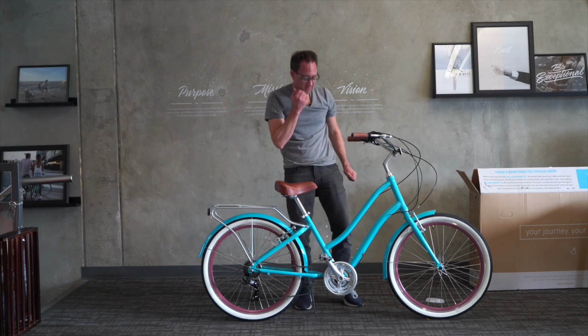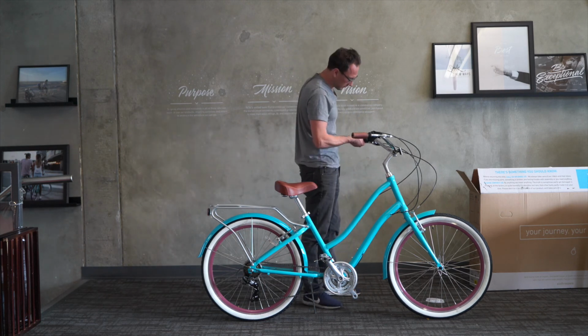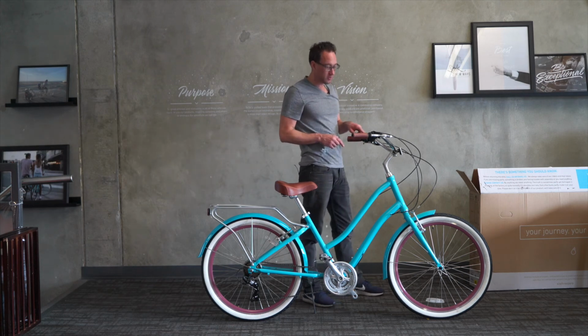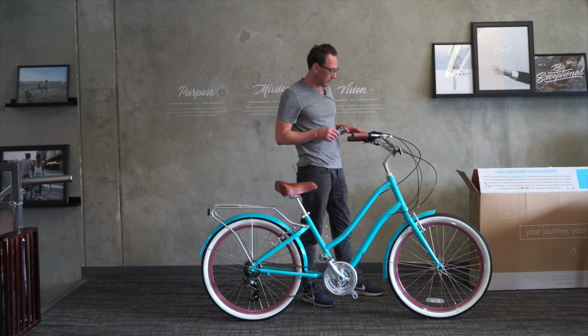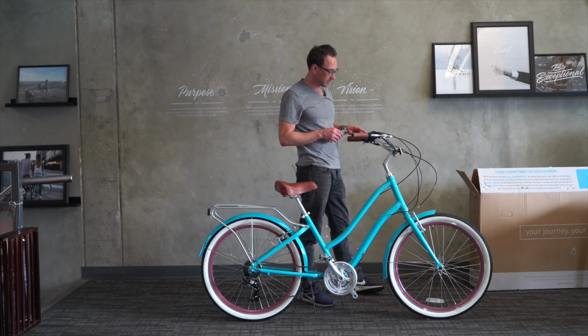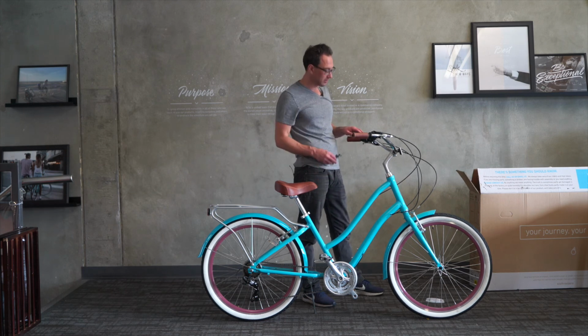This bike's already in the small chainring, so we'll also make sure that the shifter is in the lowest position. This is called a friction shifter. They come in different ways. Some of them will have a plus and a minus. Some will have little notches or even numbers on it. So there might be 7 numbers, but there's only 3 gears here.